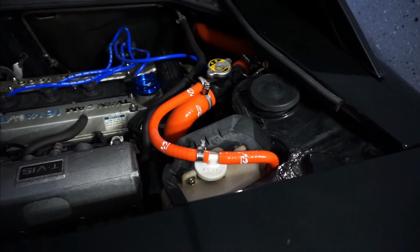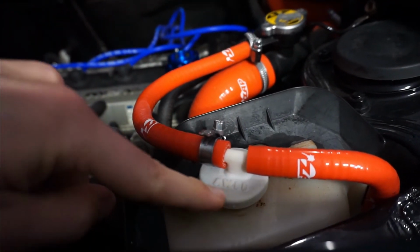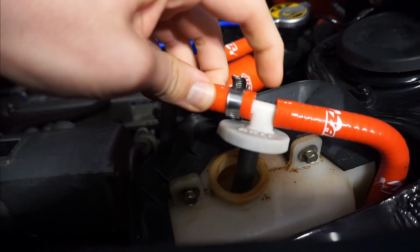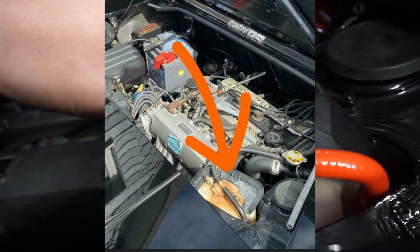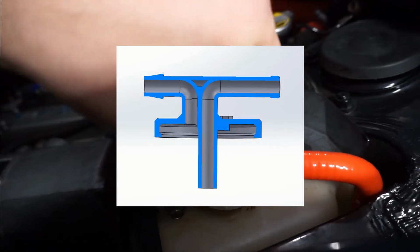The third part is the coolant reservoir cap. A lot of them break on top due to the sun radiation and weather conditions. A lot of requirements come together at this part, like water tightness, minimum 90-degree heat resistance and stiffness to have a tight fit. I designed one with a double wall on top, but still with the OEM functions, of course.